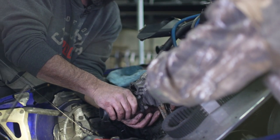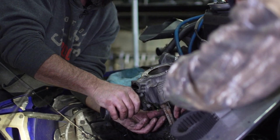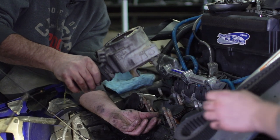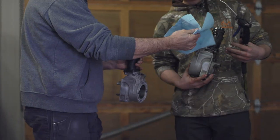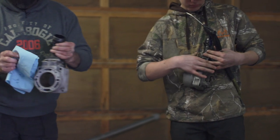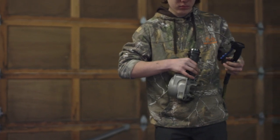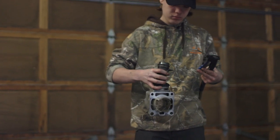We were planning to clean up the power valves on the 700 anyways, but this broken cable will be an issue — and it's been broken for some time, by the looks of the guillotine I had to pull out of the cylinder with a pair of pliers, which was a real bear to clean up. Unexpected issues like this are always possible and will push back the finish of this job while we're waiting for a new cable to arrive. At least it's a part on the outside of the engine, so we can continue with the cleanup of the parts and reassembly.